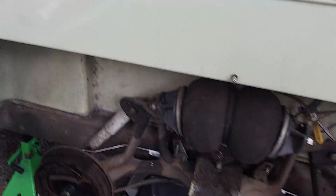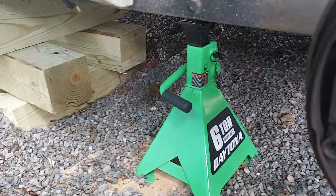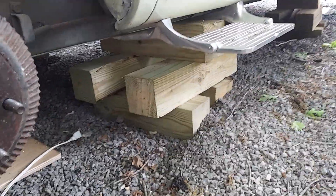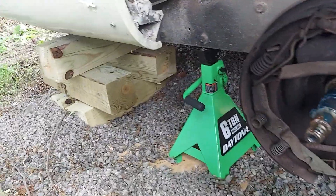Good Wednesday morning, working on the motorhome this morning. I got it up on cribbing and you can see here — six by sixes — and I've got a jack stand for backup sitting on a board. There's not any weight on the jack stand; that's all on the cribbing there. I got another set of cribbing about halfway and then a third set at the front. So it's pretty rock-solid — it's not going anywhere, safe to work on.